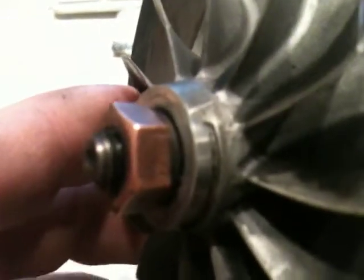It will calculate the balance of both wheels, and they will either make notches — like this wheel here has been cut out just a little bit. That wheel has been balanced and had some cuts made on it.